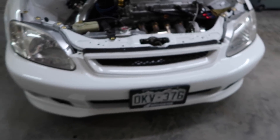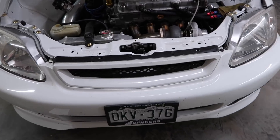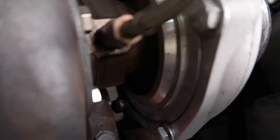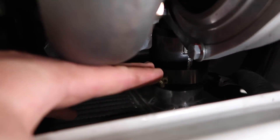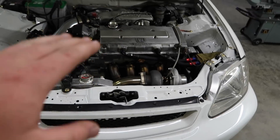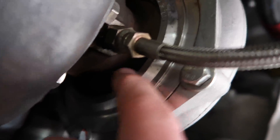When he first got this thing tuned, I told him I wanted to have the bumper on it. I told him he needed to make mounts for his intercooler, and of course, they never made mounts for his intercooler. Now if you check this out, it moves this whole turbo. The intercooler is just coupled right to the turbo, so all that stress — every time it hits a bump, it's just pulling down on it. So it messed up where the snap ring goes into the turbo, this whole piece spins, and it cracked the manifold.